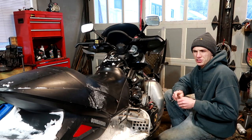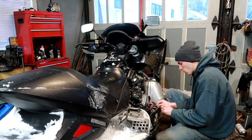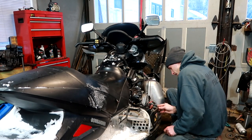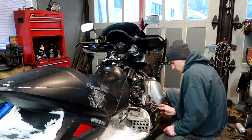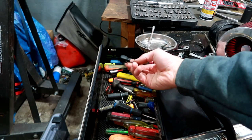This also might be the reason why this sled was kind of running like crap last night — it would just kind of stall out. A lot of machines need the battery connected even while they're already running, so in instances like that, if you don't have a nice connection, it's no surprise that things can go sideways.